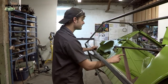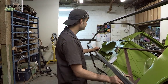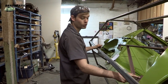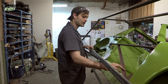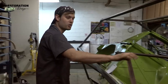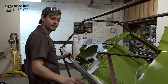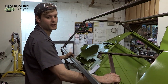I also have these door braces in there. I made them by just drilling out some holes in this angle iron and then welded the angle iron in between once I had the proper gaps in the doors. The importance of these braces is to ensure that the car won't twist out of shape when welding in new panels.